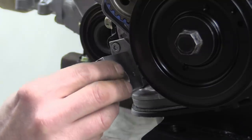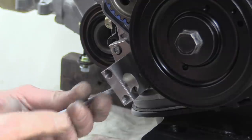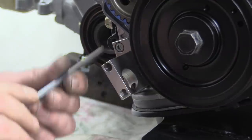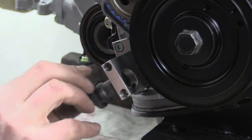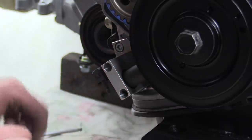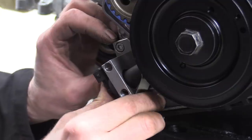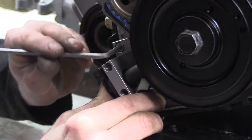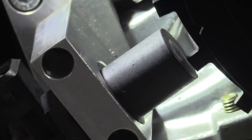One of the bolts that hold the oil pump housing on, and the new bracket is bolting on there, as there was no other handy location to fix it. But with the two bolts nipped up, the crank angle sensor can go in. The face of the sensor needs to be very close to the teeth for reliable and repeatable results, so a feeler gauge is used to set it all up before everything is tightened down properly. The gap is set to roughly half a mil, or 20 thou if you're that way inclined.